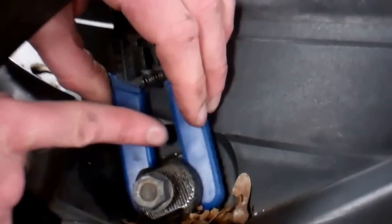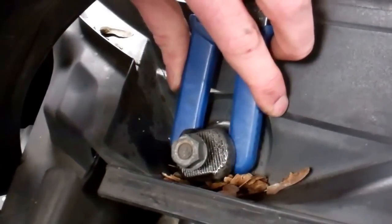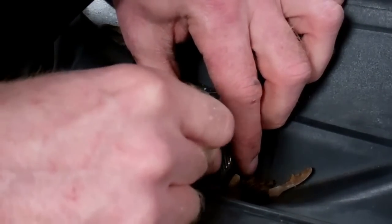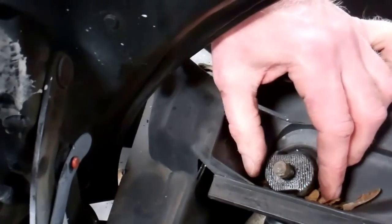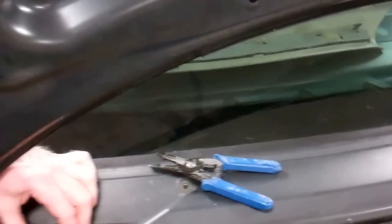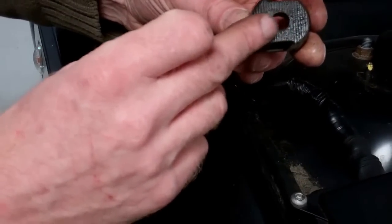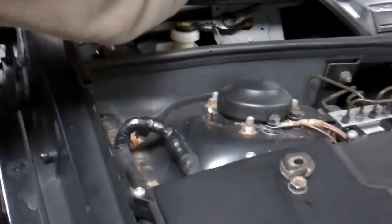Actually it wasn't very clever — we split the plastic there. But there's something quite solid; the wiper motor is behind it. So what you really want to do is get something wedged in — we used this handy pair of pliers that just fit in between, tapped it, and that released this little aluminium interface plate. One tip: mark where your windscreen wipers were lying. If you haven't got enough dirt to show it, put masking tape down first. The slug side goes to the wiper motor and the smoother side goes outwards, back next to the cowling.